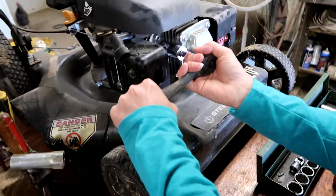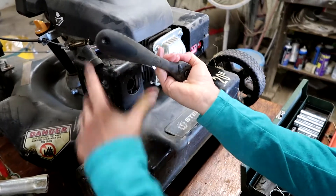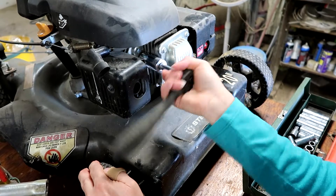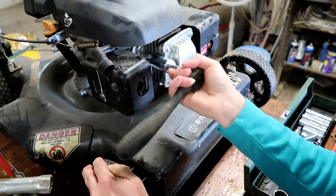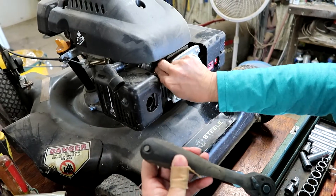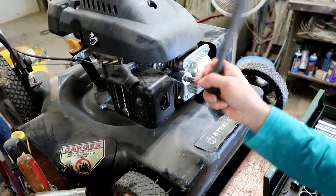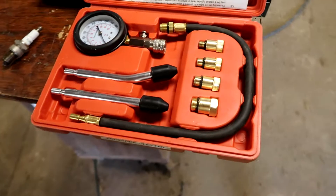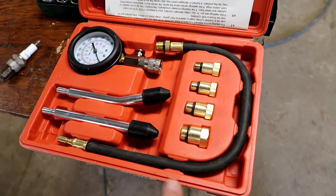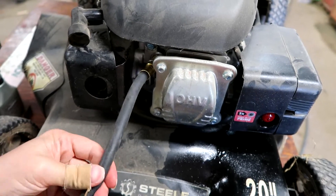Vicki is going to take out the spark plug. Encourage it to come out — she does have a deep socket wrench and that's gonna give us access to put in the compression tester. No wasted energy here though; we have to look at the spark plug anyway. Here's our compression tester kit — this will not break the bank. I got this off of eBay and paid a full $17. We just screw the hose into the spark plug hole.